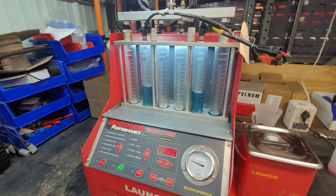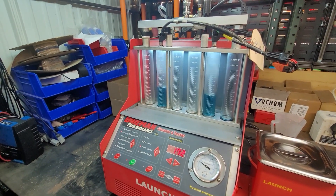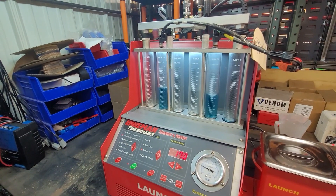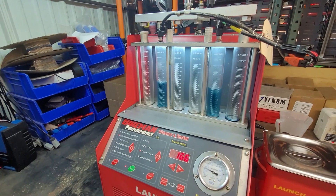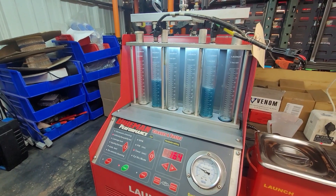We'll run this fuel, fill the injection tubes up here to 100 so everyone gets to 100 first, and then that tells us the percentage of loss on the one that's low, if it is low.